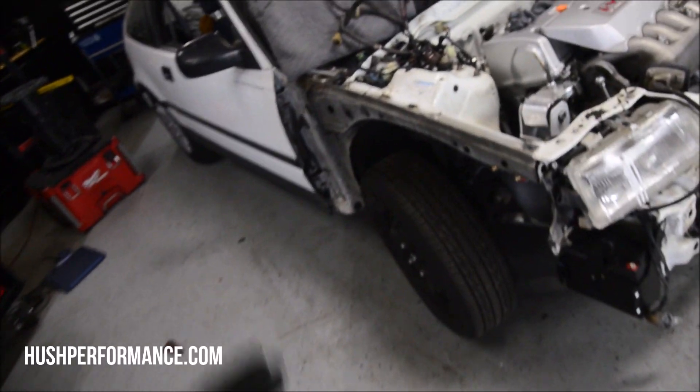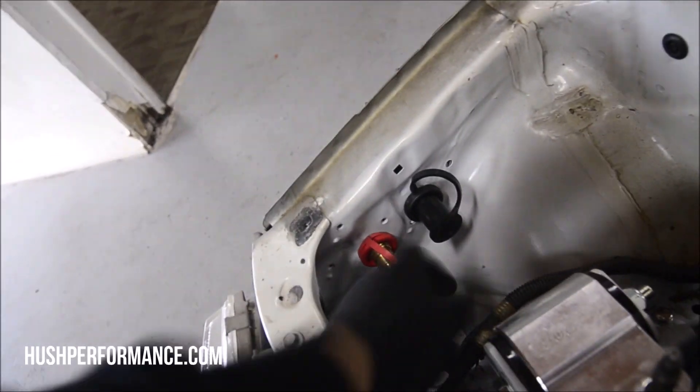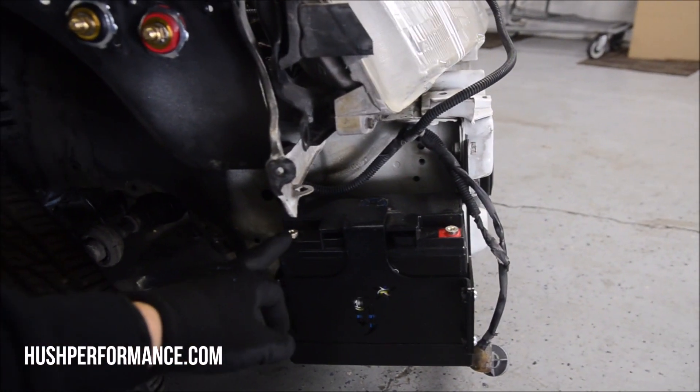Coming back to the car — what we were waiting to dry was the paint here on these external battery terminals. You pop this off and that's how you access your battery once the bumper is on. With a factory bumper and factory fenders, getting to these leads could be difficult. What we would do is extend the leads — we'd have a ground going somewhere, another lead to the ground post, then one going to the alternator, and another one so your jumper box or battery cables can reach. I was going to finish up the battery in this video but I think I should wait, since it's part of the rest of the chassis harness and we have to run a lead to the fuse box which we're keeping in the bay.